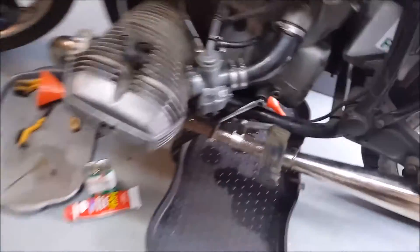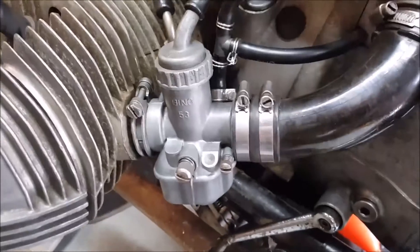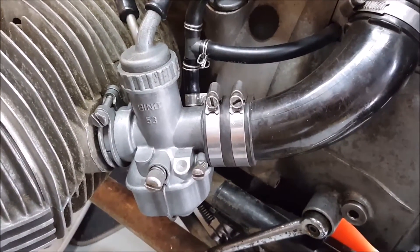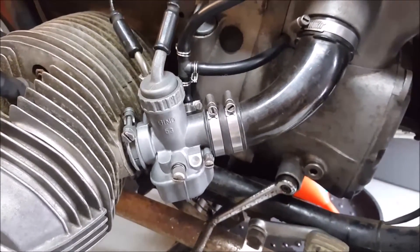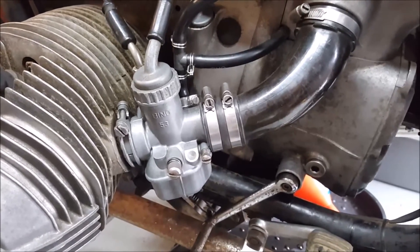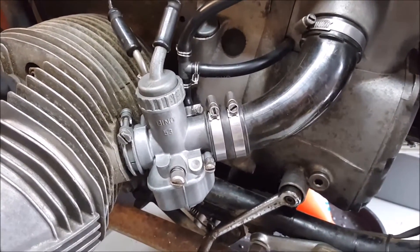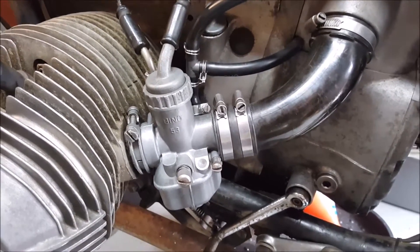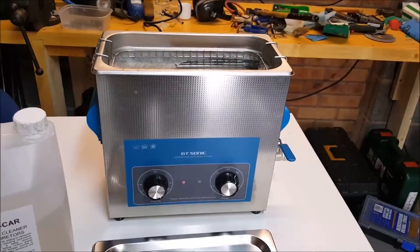I recently bought an old motorbike with carburettors, like this one. It's actually a dual carb bike, so the one I'll be talking about today is already off the bike. It's full of carbon, baked on fuel, all sorts of muck. I was struggling to get them effectively clean with a wire brush — it was just too much stuff. This is a 39-year-old bike, it's been off the road for about the last 15 years, so it's pretty gummed solid. I did research and decided to buy an ultrasonic cleaning tank.